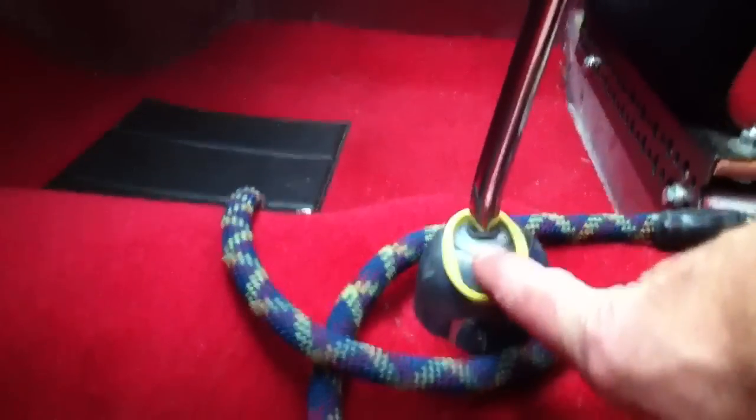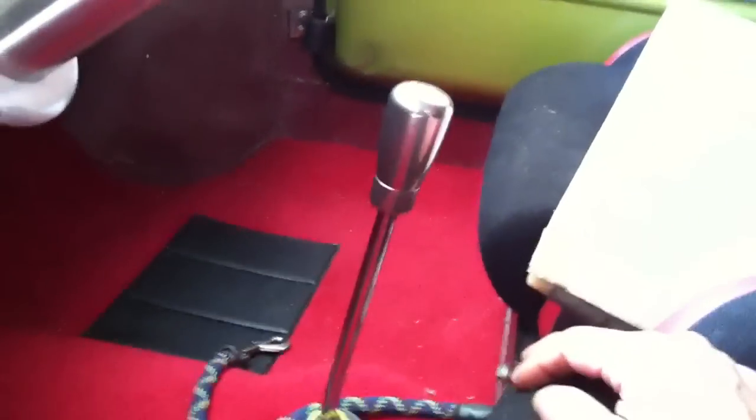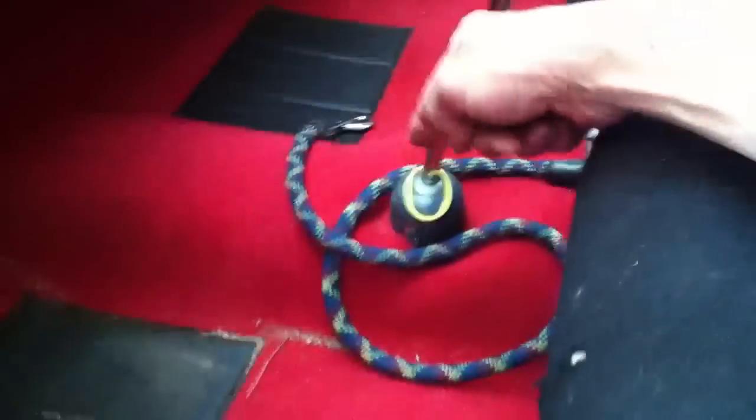Some people prefer more free play up here so it doesn't engage quite so high up, but I like the feel of this one. We talked a lot about the short shift — this one has the short shift, which all it does is jack this pivot point up so that you have a longer throw underneath, which basically makes the top have to move less. There's neutral — this is a very tight setup and it does work nicely if you get it all hooked up right: first, second — neutral, very sure where it is. Now there's a lot of wear and junk down below; there's not enough travel with that longer rod to engage the gates and reverse cleanly. People give these things a bad name and say the short shift kit doesn't work — it does work if you pay attention, understand what it's trying to do, and work with it.